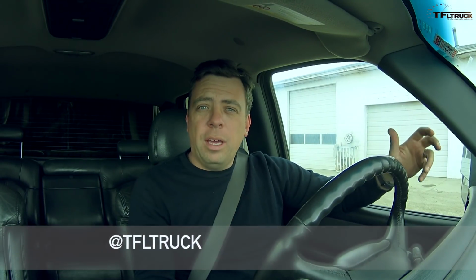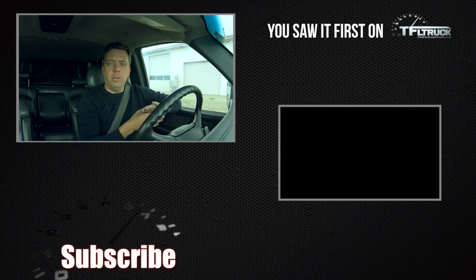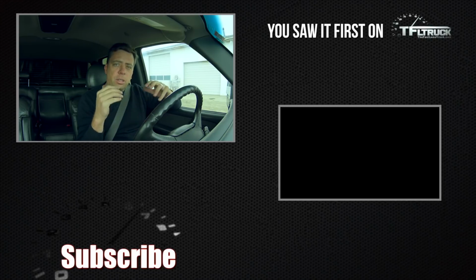A lot of new trucks have your payload rating in the door jamb of the driver's side door on the yellow tire pressure sticker, so it will tell you precisely what the payload capacity of your truck is. And if it's less than 1,400 pounds, you cannot carry a camper and put people and gear in your truck. So matching your truck to a camper or your camper to a truck is not very difficult. You just need to know your weights, your sizes, your dimensions, and you're good to go.